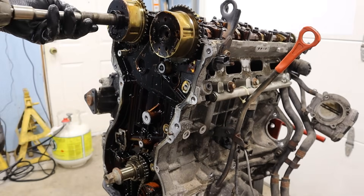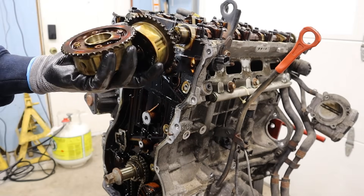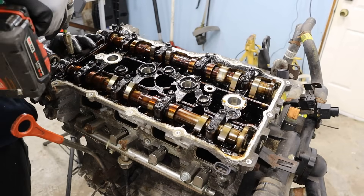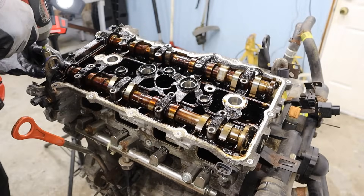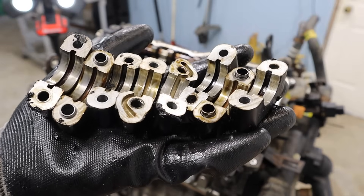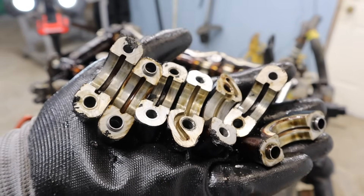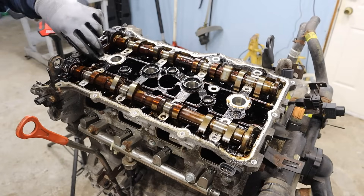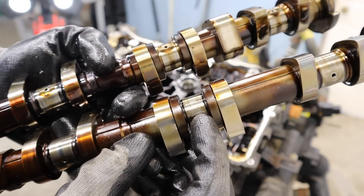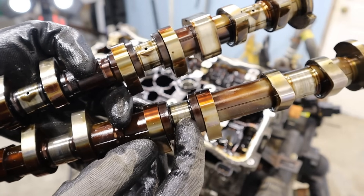Now if you want to learn more about how variable valve timing gears work, check out my video linked above. I'm going to remove the camshafts from the top — let's get these caps off. Check out some of the grooving on these camshaft bearings — that indicates there was probably a lack of oil at some point. I'll remove the intake and exhaust camshafts, and if you look closely, the bearing surfaces are also scratched up. I have two gloves on and I can feel that roughness.